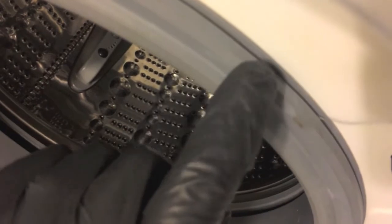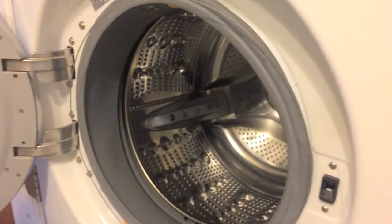On the back side of the rubber seal there is a locking ring, as you can see in there. Be careful — you don't want to rip this if you use pliers to pry this ring off. Make note of where the actual spring connection point is. In our case, it's on the lower portion of the ring.